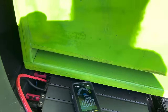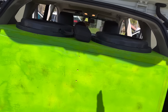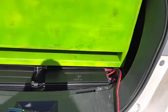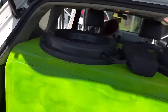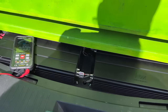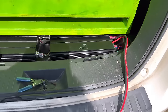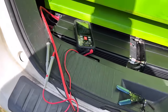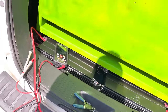Right now they are gain matched — each amp is at a half ohm. When I went to sub to DB Drive they told me they sent dual ones, and they're running at a half. So they're at a half. I got them both gain matched. I think we set them at 90 volts AC, unloaded. So right now all I've got to do is put some ends on these wires, get them on those studs, and this car will have bass.